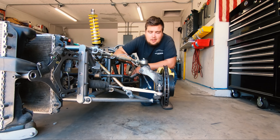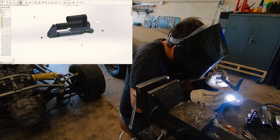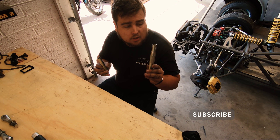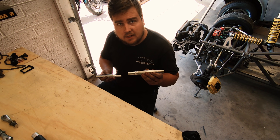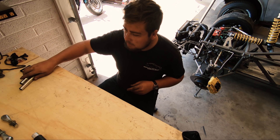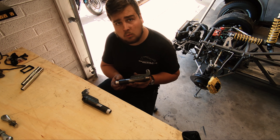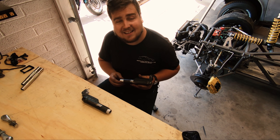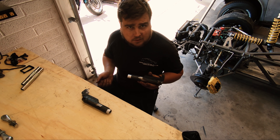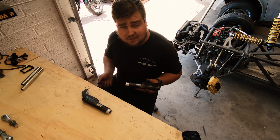So we can look at that, but first I want to adjust these, which would adjust the camber in any situation. Originally this car had standard 5/8-18 swage tubes that you can buy from any retailer, and they adjust in and out to adjust camber and a little bit of caster. But what I'm prototyping is one of these — I have two, one for each side. For right now we're going to put a linear actuator on here, and this actually has another part that goes right there that'll adjust in and out based on that.